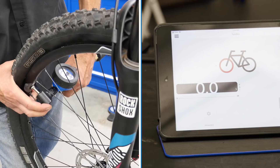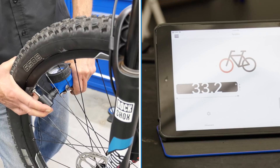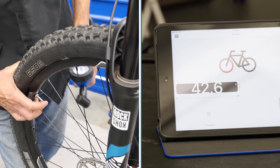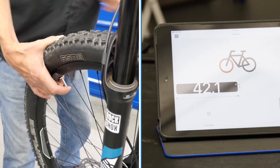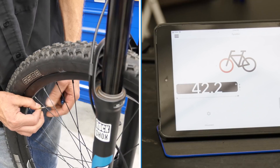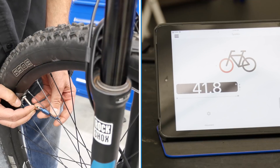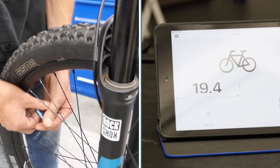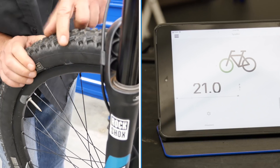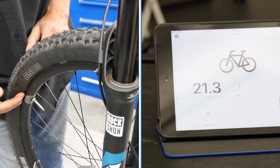I engage and let it rip. We're good there — I'm going to over-inflate. Let's get some more air in there — 42. Then stop it. Kind of hard to ride this way. So what we're going to do is put the valve core back in. See if I can get it in quick. It's 20 — I made it. So even when I was slow, I did drop some, but I have plenty of pressure to ride with. Bead is nicely seated. Ready to go.